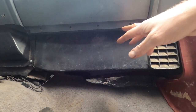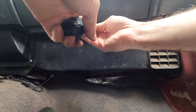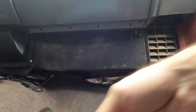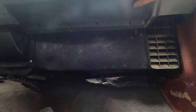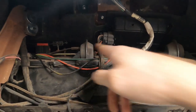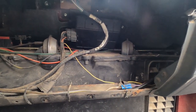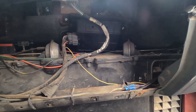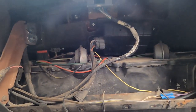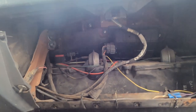To remove the glove box, there are four Phillips head screws here. Okay, those are out now — open the glove box. Underneath here we have both of our actuators for the air controls, for all the vents. What I'm going to do is go take the dash off of the OG crew cab, take some pictures of where all the vacuum lines go, make sure these ones are all in the correct spot, and then go from there.